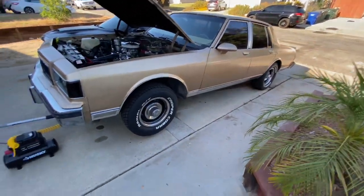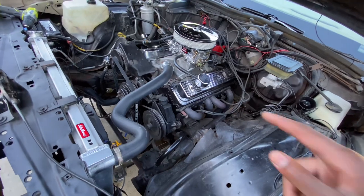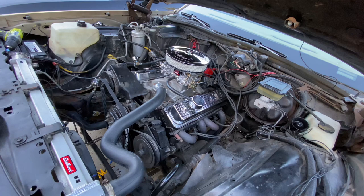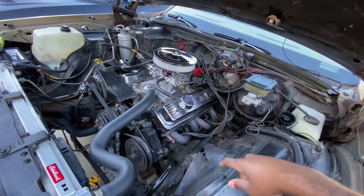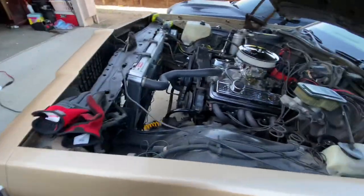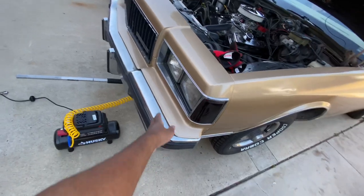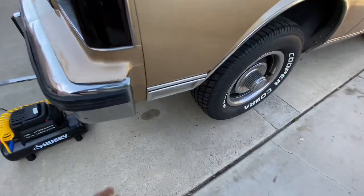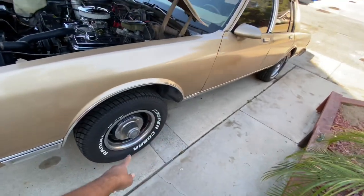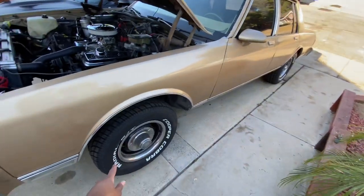This is the box Chevy — I'm almost done with it. Once I get the shocks on that'll be the end. It has a 350 in it, got headers, just put a new Edelbrock carburetor on it, new distributor, new plugs and wires, new belts, new hoses, electronic fans, and I pretty much changed everything to LEDs. I put the rally wheels on it — 15x6 in the front, 15x7 in the back. In the back I got 275s, in the front I got 235s.